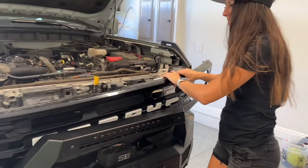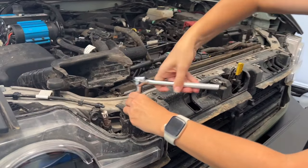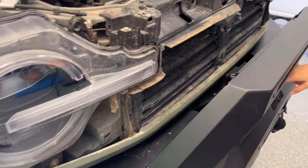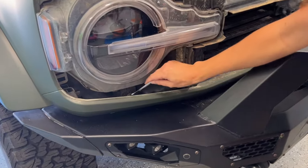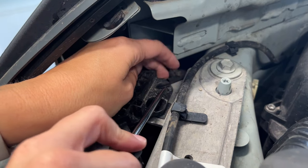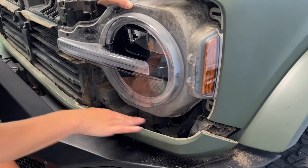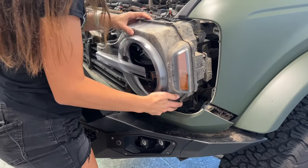Just like that, and then you can remove it. I'm going to use a 10-millimeter socket. There's a bolt here that I'm going to remove, and there's also another one right here. You could easily take this valance off, but I have a winch right here so it's going to make it a little difficult to pop off. So I'm going to use an 8-millimeter wrench to just remove this bolt. Now that I have the bolts removed, there are little pins right here in the corner of each headlight that I need to remove. I was able to unsnap the valance enough to get the bottom part of the light to clear, then you just pull this out — and the only thing left connected is the wiring harness.